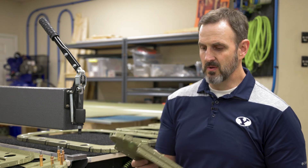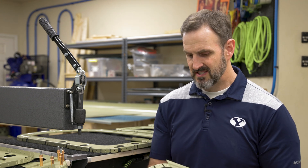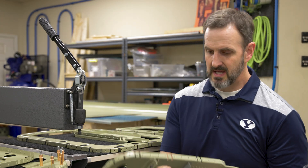Anyway, this is basically it for this video. Other than waiting for the tank sealant to dry on my trim tabs, I'm finished with the elevators - at least for now. I still have to put the weights in and put the fiberglass fairings on, but I'm going to do that at a much later date. I'm kind of happy with that. Next, I've actually been working a bunch today - I put together the tail cone, took it apart, drilled, primed everything, and started riveting some of the substructures together. My next big step is to actually assemble the tail cone, so next video I'm going to be doing that. That's it for now.